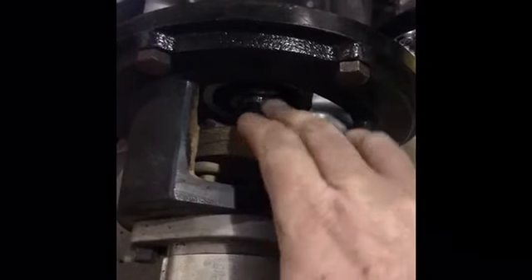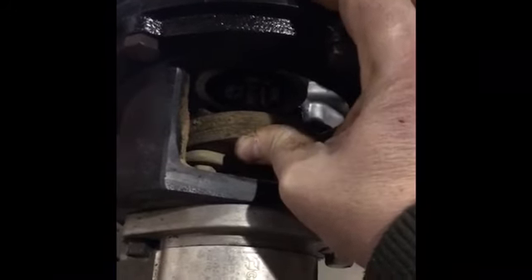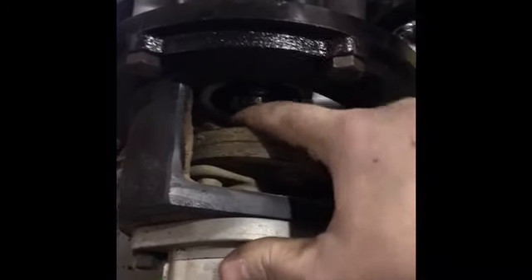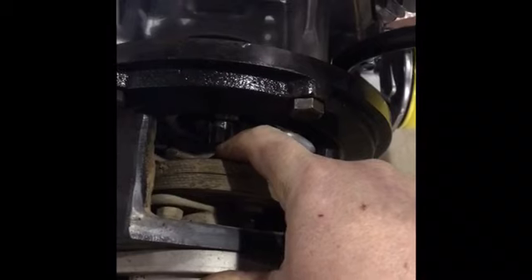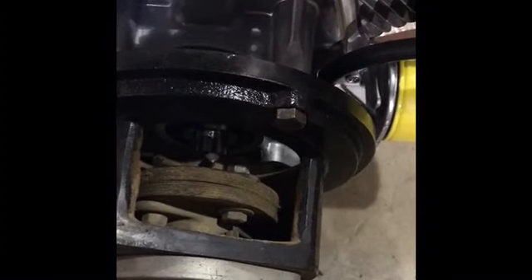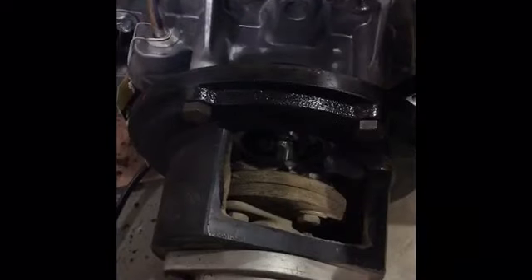After you've got it in there, tighten the bolts and make sure the part isn't bound or misaligned — just make sure it's in the right position. Then lock the two square bolts back down on the crankshaft. The keyway is much shorter than the slot on the crankshaft so it can move in and out — make sure that bolt is actually on that keyway.